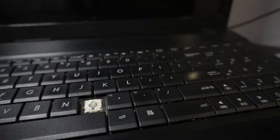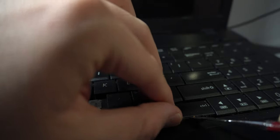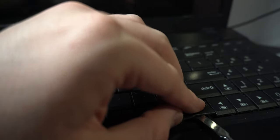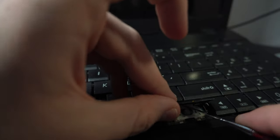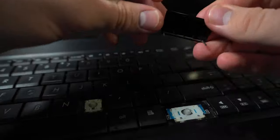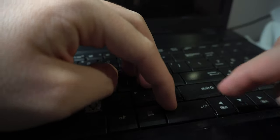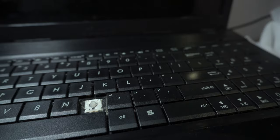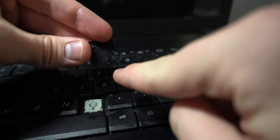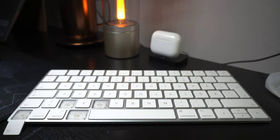Let's try this keycap — boom — and there's the other plastic part, boom, perfect. You can just twist or do something like this and it's off. You can use really anything you want to clean it. I will also clean and make this metal part nice. Okay, now press it back and it's perfect. The loud noise is of course from those hooks, so you don't need to be worried — just snap it back like this and it's working. Let's go back to the main event, which is the Magic Keyboard.